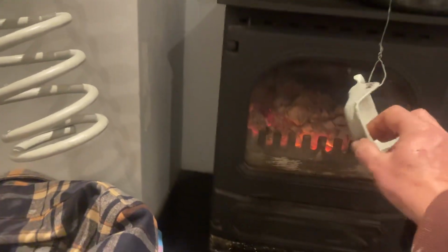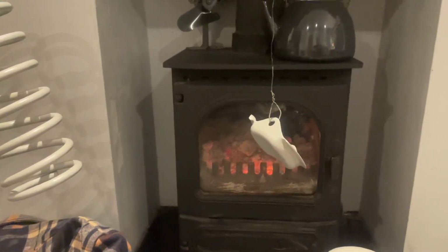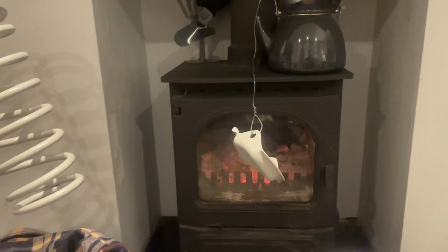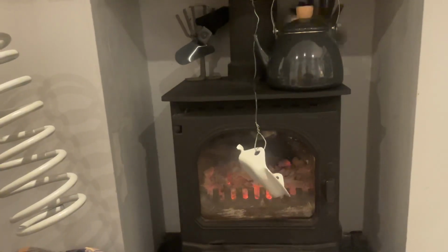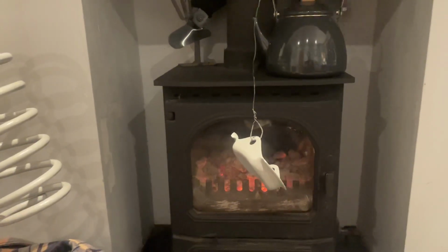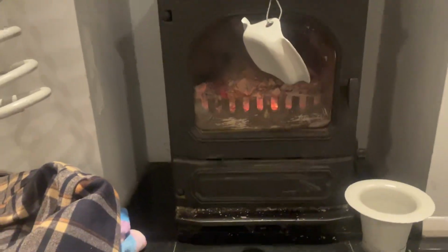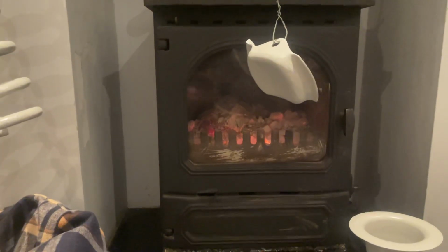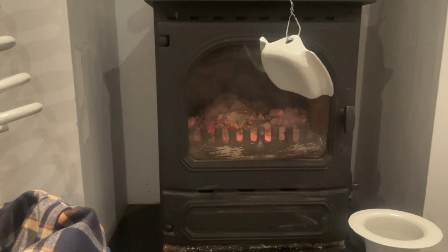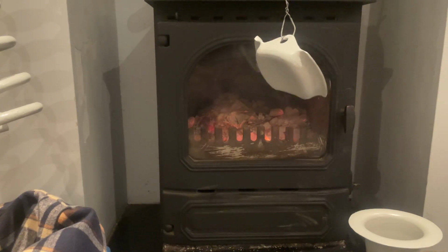That's in the 2K epoxy primer, which hence why I've got it in front of the fire, because I'm just warming it up. I think epoxy primer normally cures in about 2 or 3 hours with about 60 odd degrees, but that'll be cured in the morning, and then I'll put it in what I used on my church turret clocks, which is the HMG enamel paint that they use on. It's a heritage paint. I have shown it you before.